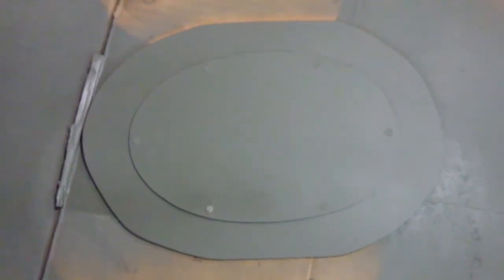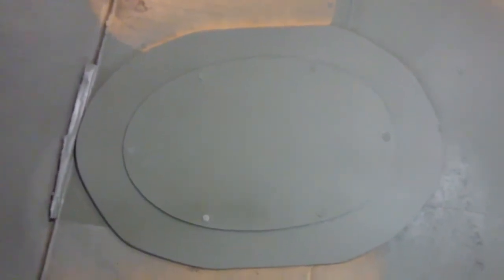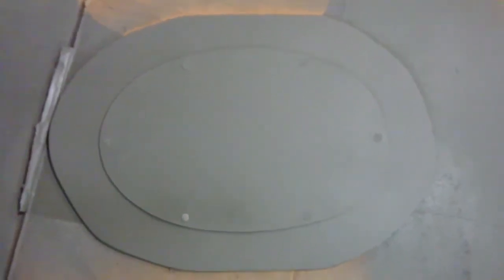Here are the two pieces — they've been primed. The holes have been drilled and countersunk for the number 40 skin rivets. The rivets have been put into place and another coat of primer has been put over the top of everything. This is ready to match up with the lower cowling and be drilled and riveted into place. We're going to let the primer dry overnight since it's still really soft right now — we'll do it in the morning.